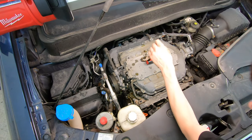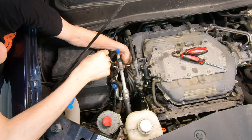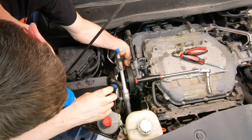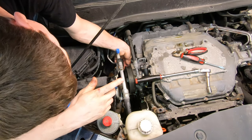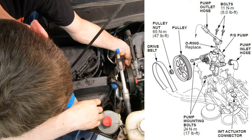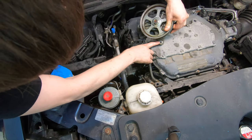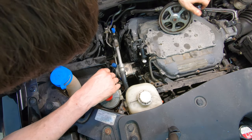First thing I'm going after is the power steering pump. There's a suction line coming off the reservoir that we'll have to unhook and tuck out of the way — that was only a small environmental hazard. The bolts on the power steering pump are 12 millimeter. This stuff is rather buried in here, so I'll roll whatever camera footage I can of the bolt locations. With the power steering pump sitting on top of the intake, one bolt is here and another is down on the bottom — both basically on the bottom of the pump.